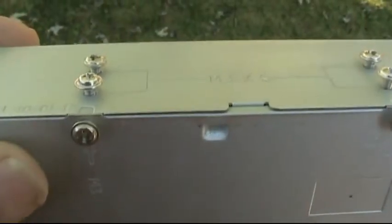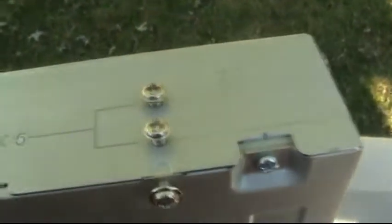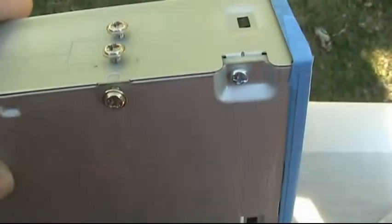With the appliance epoxy, you don't have to use a primer. It will stick to anything — just give it a light sanding and it will stick. You see I got the screws and the holes covered, just so that the paint doesn't get on the inside and gum up the bands and all that stuff, and so that you'll be able to use the screw holes a lot easier.